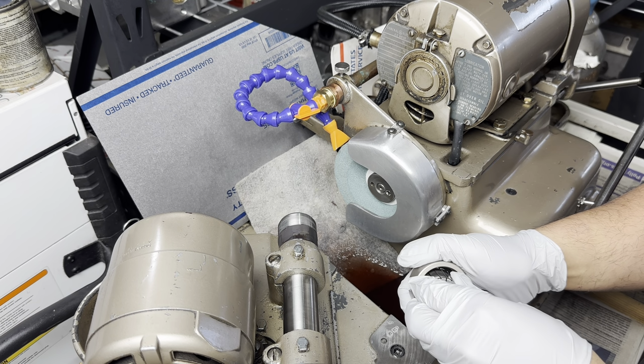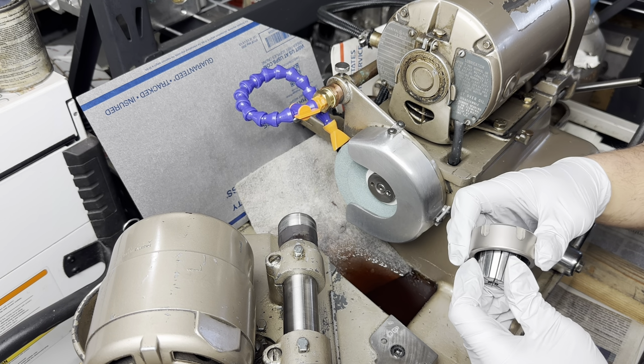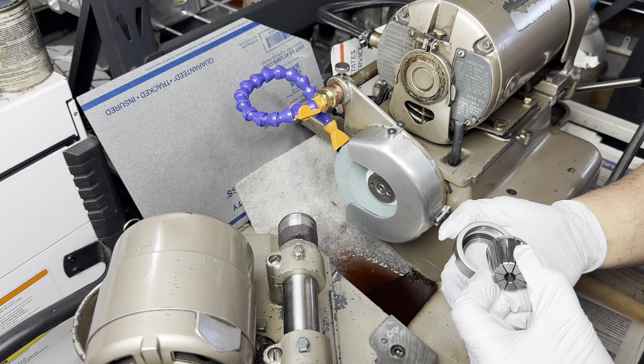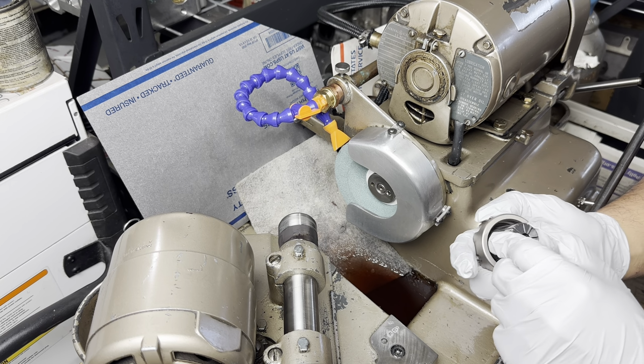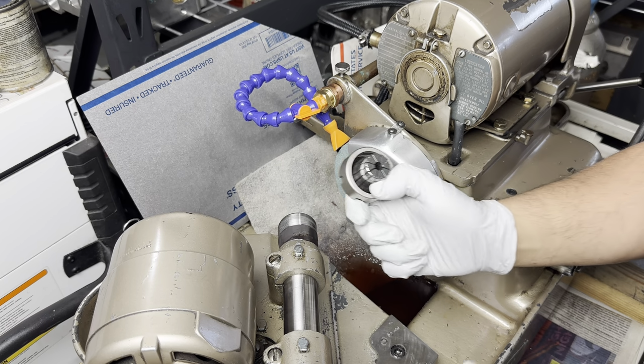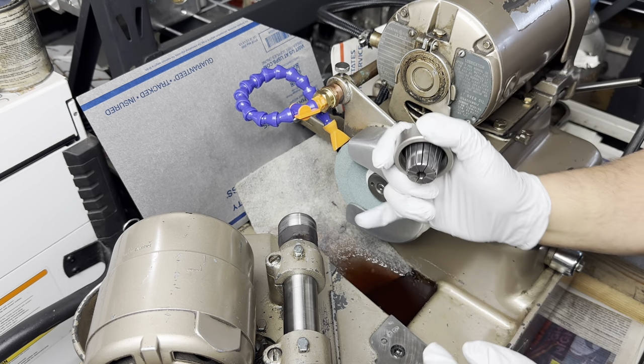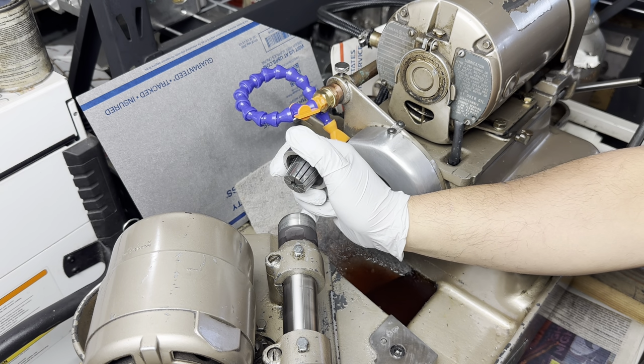ER32 installs on the nut. There we go. Nope. Come on, find the hole. You've done this before. There you go. Shouldn't fall out. There's just a taper here that acts on the front of the collet and it pushes it into the taper